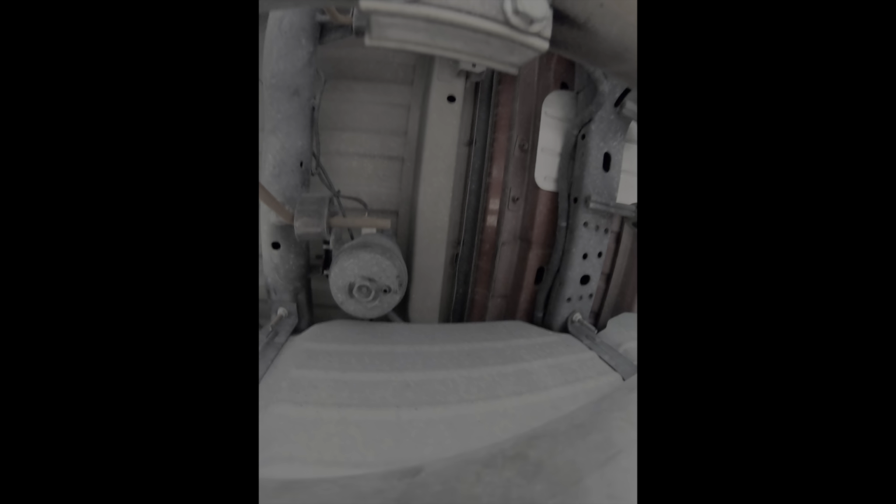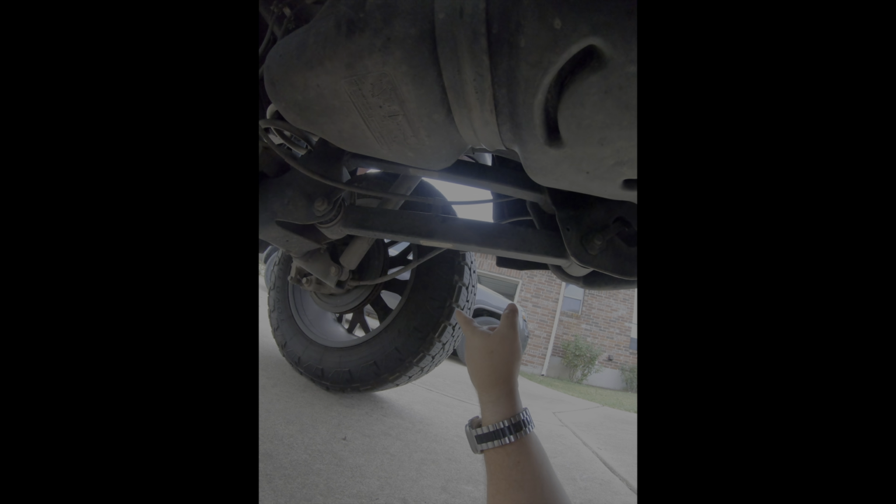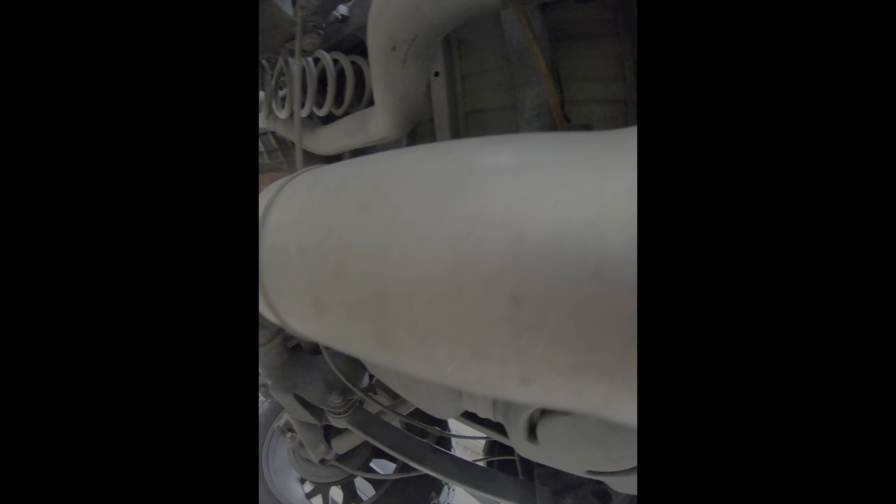Okay, so the first fuel filter that we're going to do is here. I will drill part of this out, so you'll see this hole right here. I'll drill that out. We'll take this off, we'll allow it to drain, but this is where the 8 millimeter is. We'll drill this and put the line in, and then that'll drain down here, right? So this is the driver's side rear, and of course you can see the DEF tank, and notice there's no reason for the DEF tank to still be here, but it still is. So anyway, let's get that piece off of there, shall we? Let me drill it out a little bit. Hang on a second, let me get this situated.